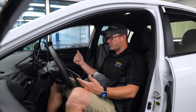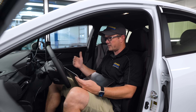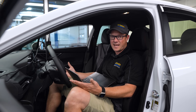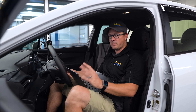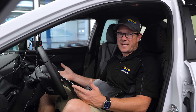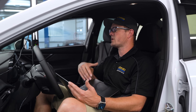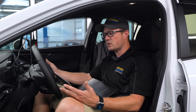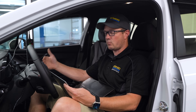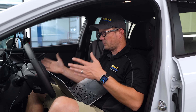We often do ethanol blends to pick up even more power, so that's some more testing we'll do — getting this car up to ethanol blends around E40 to E50, all the way up to full E85, which is something we've been testing with pretty good results. Beyond that, turbo upgrades are going to be the next thing to become popular. There are already ETS bolt-on turbo kits, and people are starting to test upgraded wheels and upgraded stock-location turbos — those things are going to take this platform to the next level and give us more top-end power.